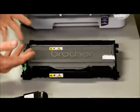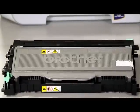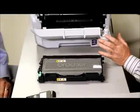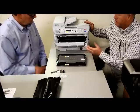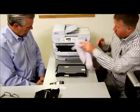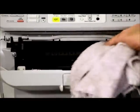Once you've got that out, there are things you should look for inside the machine. You want to look inside and see if you have any excess toner or paper dust — sometimes toners leak. Just take a damp rag, reach in, remove the excess very carefully, and then you're ready to start on the toner and the drum.